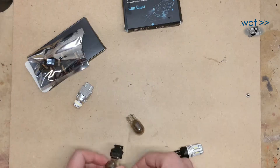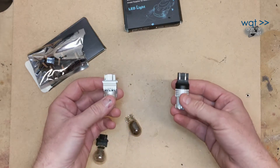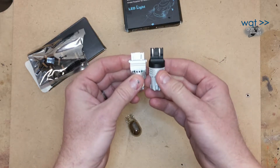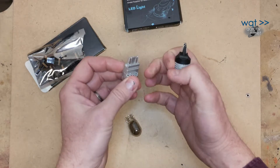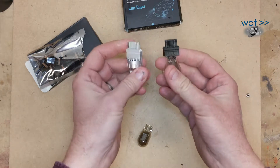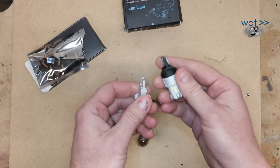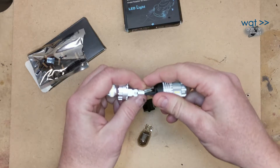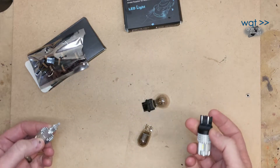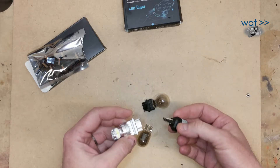If you're buying LED equivalents, sometimes they do look similar. This here is the 3157 in LED, and this here is a 7443. Notice these bases look very similar in size — not quite exactly the same width, but very close. However, this one is much longer and doesn't have the same clip retention system. So if you try to install a 7443 in a socket designed for a 3157, it might go in, it might make contact, it might not. It's actually a little bit fatter, which could jam the clips out, and because it doesn't have the same socket retention mechanism, it might fall out. Just pay attention to those details when shopping, because installing the wrong thing could result in an unreliable fixture and the light goes out without you even knowing it.